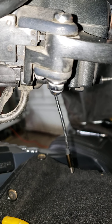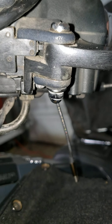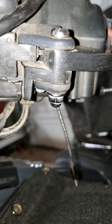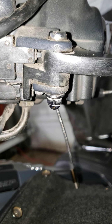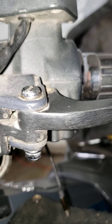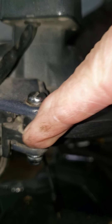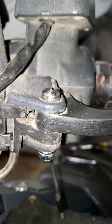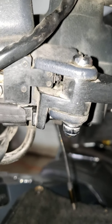Why is that happening? If I take a shim and stick it in there to give it a little more space, it'll start the bike. So why is that happening? I think it has everything to do with the fact that this bushing right here underneath in the handle is shot. It's worn out to the point where there's too much play, not engaging that switch enough.